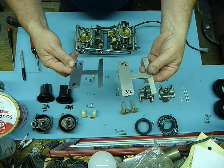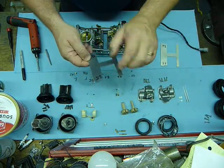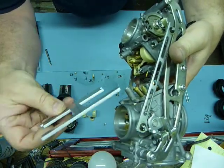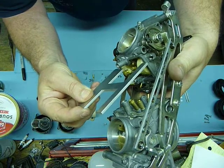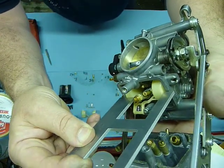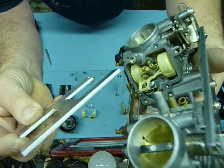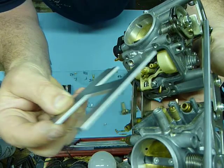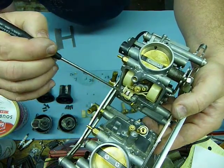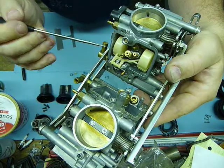These are some fairly basic measuring tools that I've created — you can get them on adventuremachines.com or advmachines.com. For the kit we typically set them at three-and-a-half millimeters. What we want the float to do is just kiss the needle. Take this tool and run it across the gasket surface — it just touches the three-and-a-half, just barely. If you need to adjust the height, go in here with a screwdriver and twist up or down depending on which direction you need the float to go.